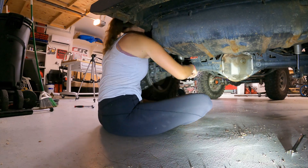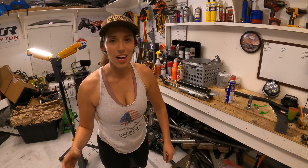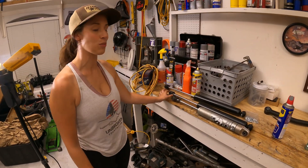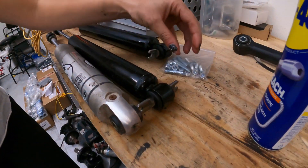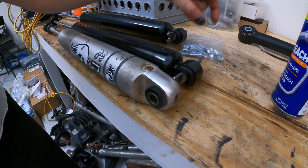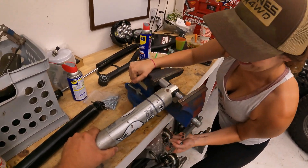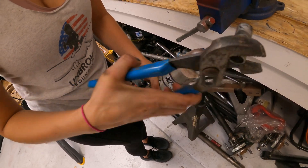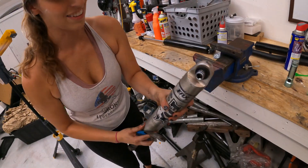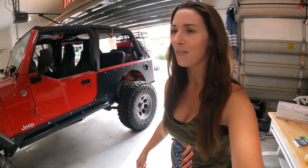Got the old shock out. The new one is three inches longer, which is going to be great. I also wanted to point out I'm running the bar pin eliminator — this is like a weak point on the shock — so I'm going to push out this bushing on the Fox one and put it on the new one. Finished installing the shocks last night and posted my old ones up for sale, and somebody is already on their way to pick them up. Ben is out there washing off the old Fox shocks.